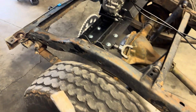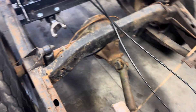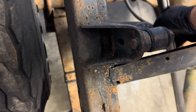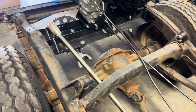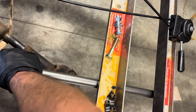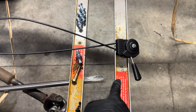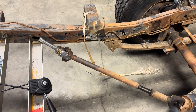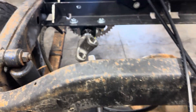And then this is the drive shaft for the transfer case center section. To kind of mock up what it will look like — this is going to take a little bit to move around — it's going to go under the bracket, shooting from here right out that direction with plenty of clearance. Then it will run parallel with another transfer case section right there. It's going to have a stub much like this setup, with a 12 tooth gear here. Once these are moved underneath and the drive shaft is extended, the holes are already drilled here, here, and on the bottom — just like that setup, just over here.